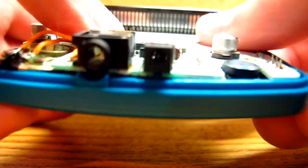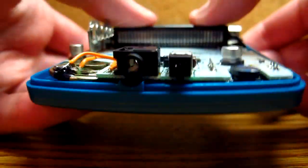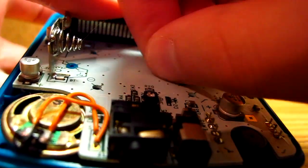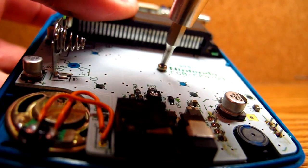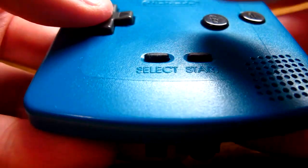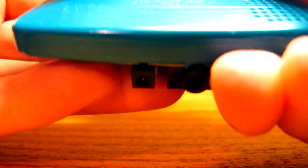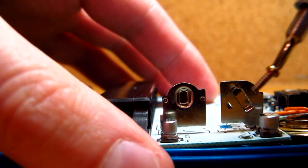I need to get off the buttons so I can actually fit this. Pushing on the buttons pushes the whole thing up because the buttons are popped out of the Game Boy Color. Just got to lift it up a little bit to get this sitting nicely. And then we're going to put the center screw in here — it's all a tight area. Once you get the center screw in, you can then check to see if the buttons feel okay when you flip it around and see if they pop back in and out. If they're misaligned or something like that, they will not feel right at all. I think everything is good here.